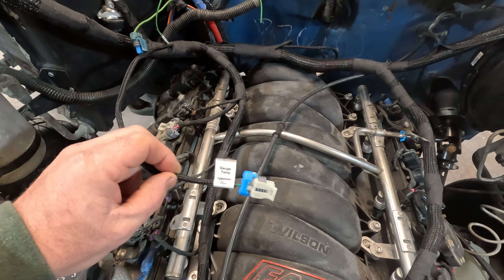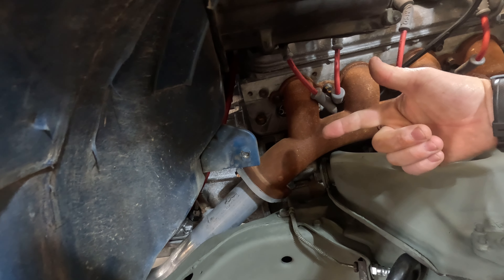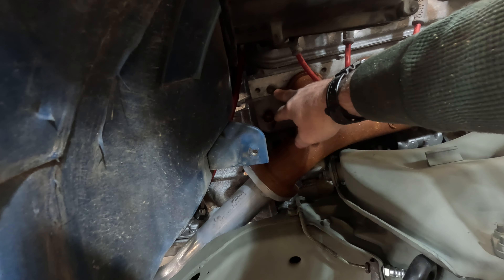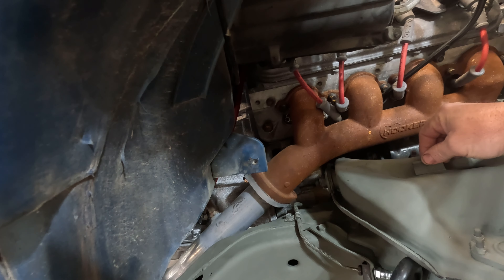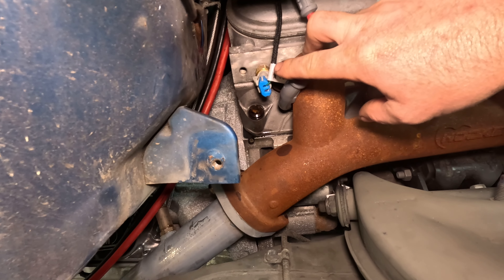Current Performance says I need to pull this plug out and drill and tap for a temperature gauge. I've already got my Rancho lift kit — body lift installed, which is just a four-inch block — so that gives me enough room. I'm going to pull this out, drill and tap, and put that temperature sensor in. I discovered this three days ago from the last video, but it took me three days to get the sensor, find the tap, and then find the drill bit — which is a 3/8 NPT, requiring a 37/64 drill bit. It's in there — drilled and tapped, screwed in and connected.